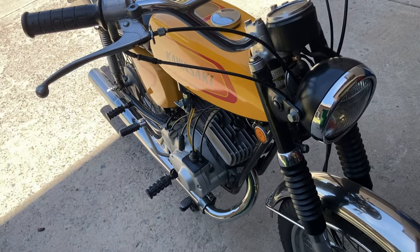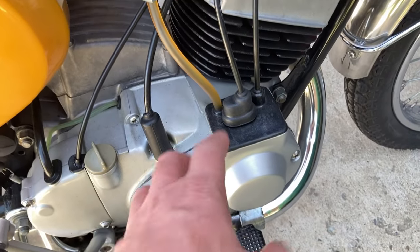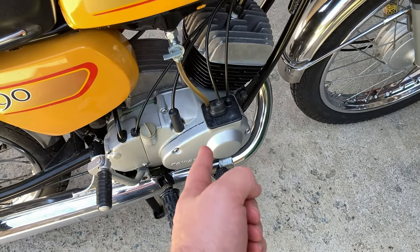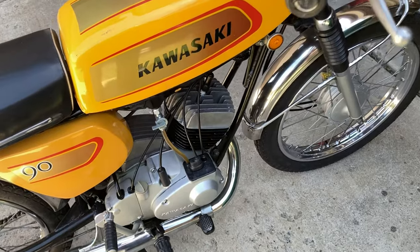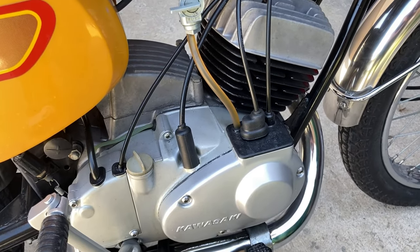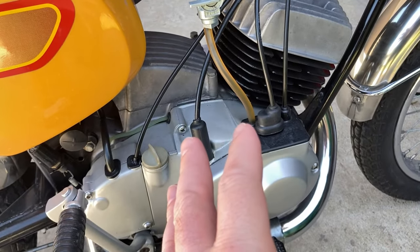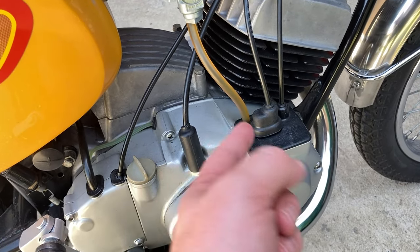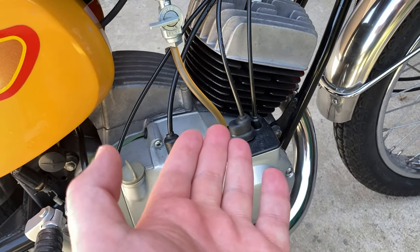When I brought it to Texas, I made two rounds around the block and the engine seized. What had happened was the rotary valve, which is behind this cover here, taco'd — it's supposed to be flat but it bent and dug into the aluminum housing, shooting aluminum right into the engine and seizing it up. It was a total loss, including the bottom end, because of how badly the rotary valve ground into the casing.